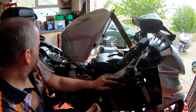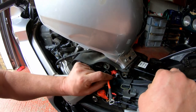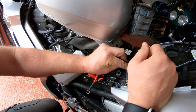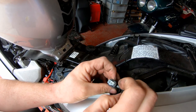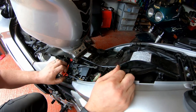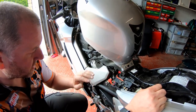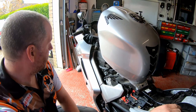Over to the other side of the bike — both cables are exiting here. I've tucked the self-setting circuit breaker into a decent-sized nook, and the positive will connect up here, the negative here. I've also got some extra wiring: one for the Optimate connector for charging the battery, and the other for the heated grips. I'll revisit reconnecting all of those when we come to connecting the battery, which we're not doing until all the stator wiring is done.